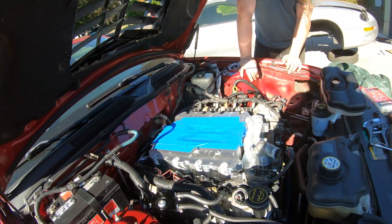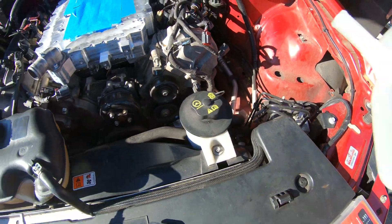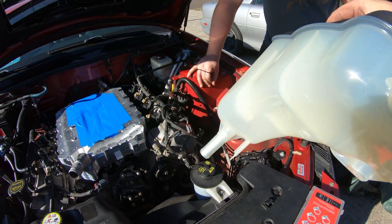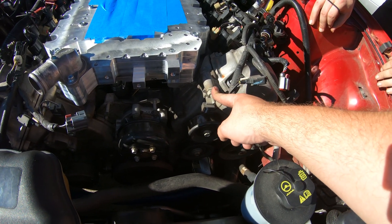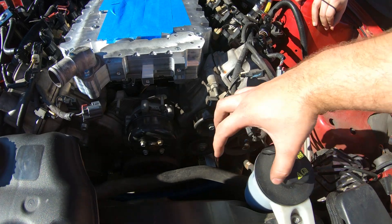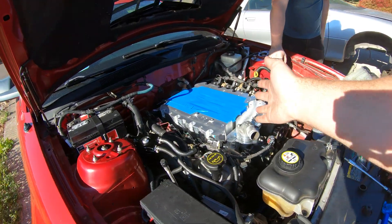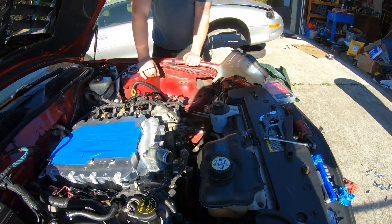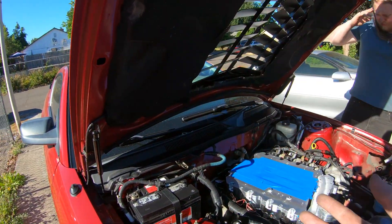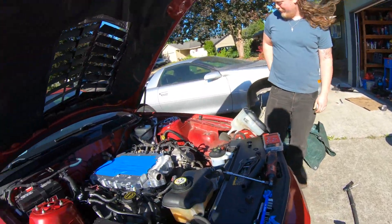I think we're gonna end it off here because it's getting late and I actually haven't eaten anything today. I just brought this out to look at it — we are gonna have to relocate the power steering reservoir because this is going to take its spot as the coolant overflow for the system. I've also seen people make a bracket off of the cylinder head, just remove something, make an angle bar, and flip it around. We're just gonna clean up and end off for today. Got it fully assembled with the manifold on. Next things we need to do: get the alternator bracket on, alternator on, supercharger on, take the front bumper off, get the intercooler system on, and ultimately get the fuel system in — I need to put the fuel pump in. So yeah, that's pretty much it for today. I hope you guys enjoyed — like, subscribe, comment down below and we'll see you in the next video.